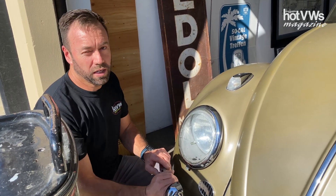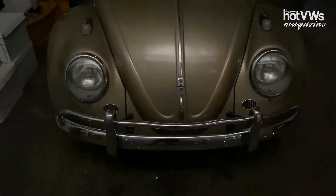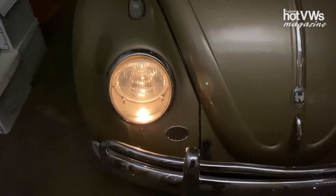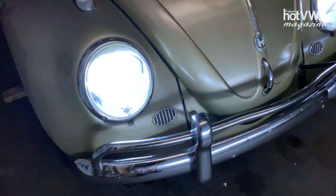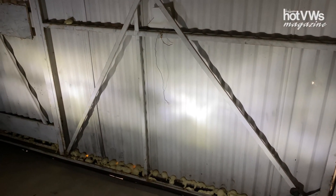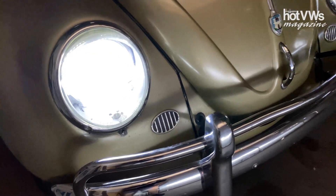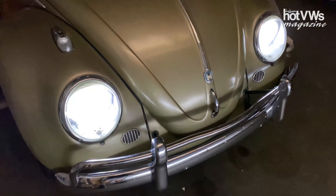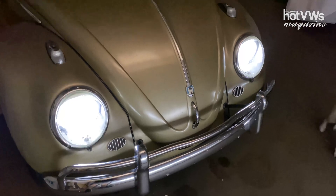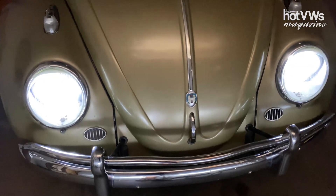You still have a US headlight assembly, but you've got the visibility and the safety factor, which is huge. In another video we're also going to cover taillights, because that makes a big difference too — especially snowflake taillights, or for early bus guys, anything from '61 and down, you want to be seen. We went ahead and put the assembly in — there's your parking light, and look at that! That is very bright — and that's six volt! You can see the difference between the high beam and the low beam, and it's a nice, very clear, directed beam. Drive safely. Time to change yours out and be safe on the road — thanks for watching!